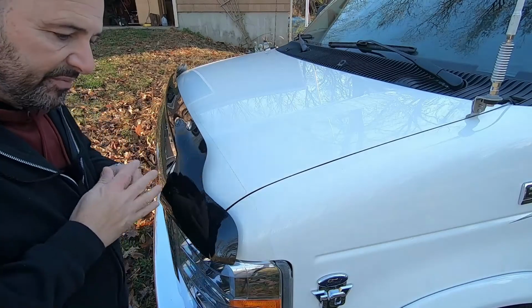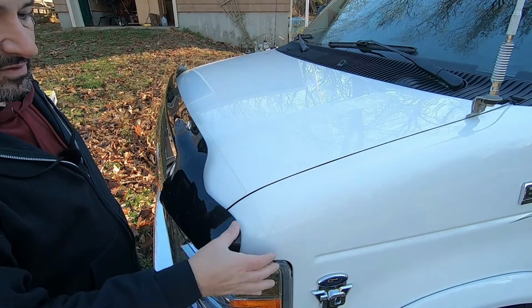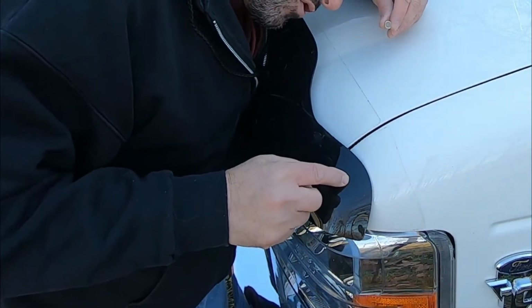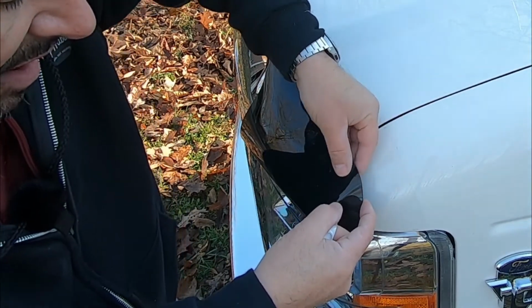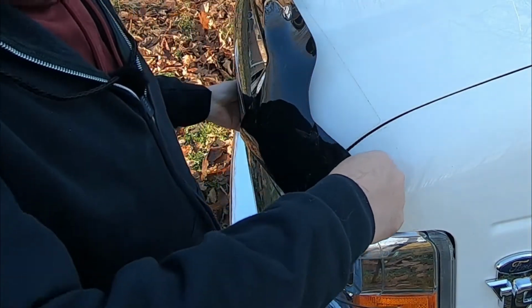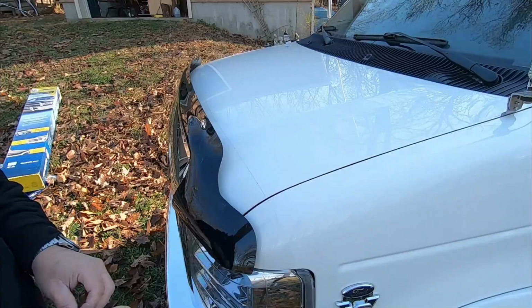So this is pretty solid, but right at the very tail end, if you get a lot of wind, this can push and hit the corner of the RV. So they give you these little bumpers, and I'm gonna see where it hits when I push. It's right at the edge, and I'm just gonna put that little bumper there. So now if that gets pushed by wind, it won't rub on the paint. It'll hit that little bumper. And I'll do the same to the other side.